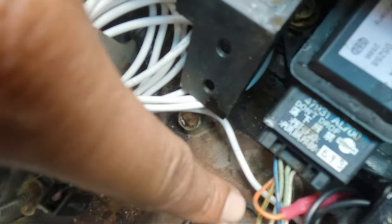After doing more research, I realized that power comes from this orange wire right there, and the car is super sensitive, like I was saying. So long story short, what you have to do is get a consistent 12 volts of power to that switch at all times, and if that is interrupted, like where I had it wired at first, up to the fuse box, it won't work. You need a constant 12 volts. When you start the car, usually everything in the car loses power for a split second and then comes back on. But the way around that is I use power from the OBD2 port.